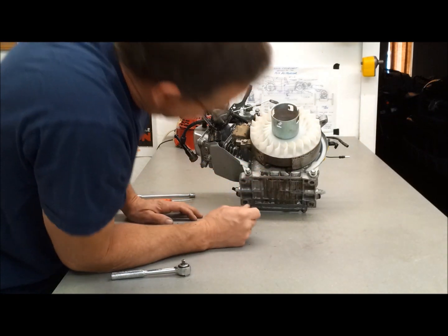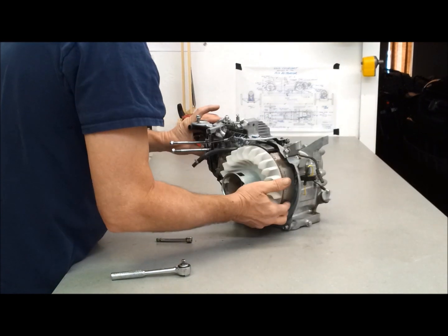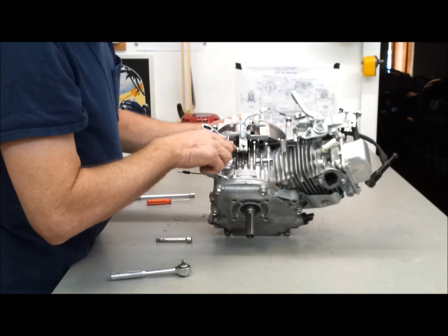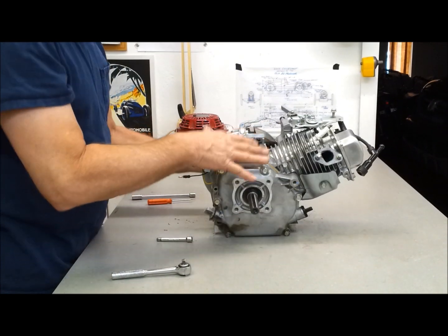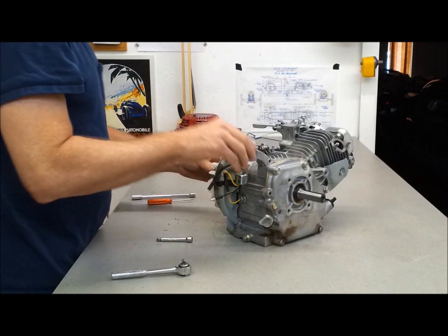There's oil on this engine and I'm not sure where it's coming from — it shouldn't have any oil on it. There's a little oil from here because the hole that this governor goes into probably doesn't have any kind of seal on it. Since this is like a stationary motor and we're thrashing it around, some oil works its way up. That'll get plugged.